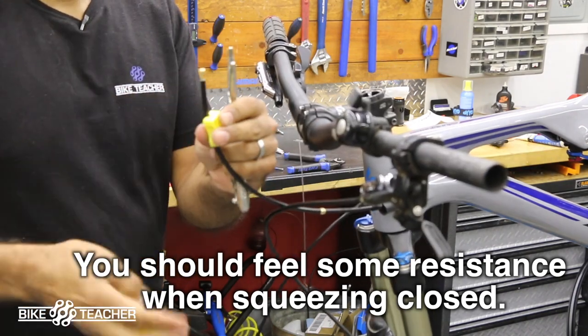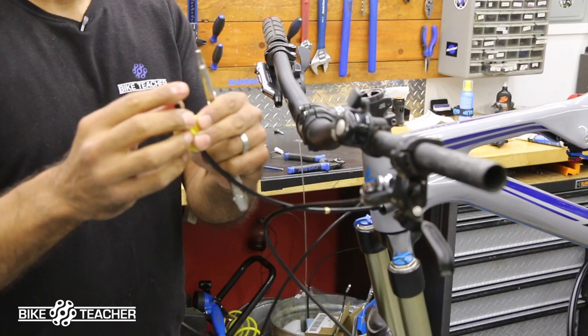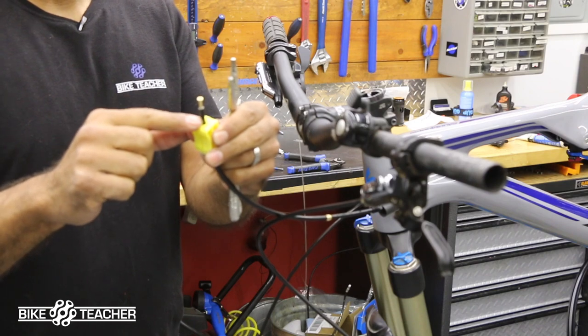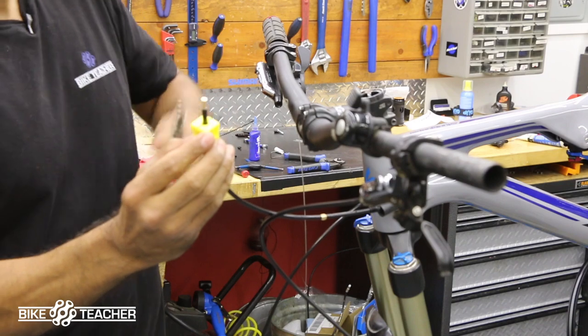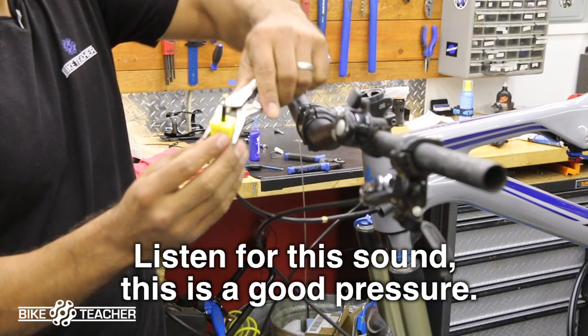So we're going to hug it, we're going to clamp down here. We want to clamp low enough to allow this barb to go down and get recessed in. You don't want this to be flush at the tip of the hose. You want to come down just a bit, allowing space for the barb to shoot down, so it's not going to conflict with these holding blocks. So squeeze there. Oh, that was a little light, I'm going to choke up on it. Okay, I like that there.